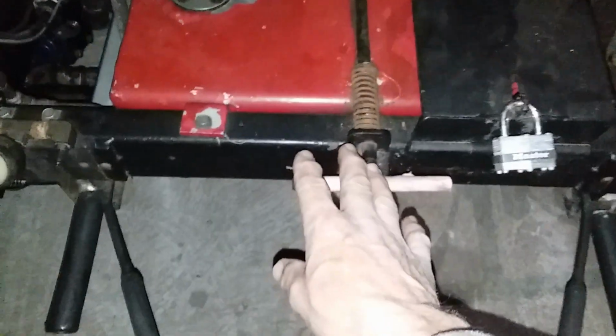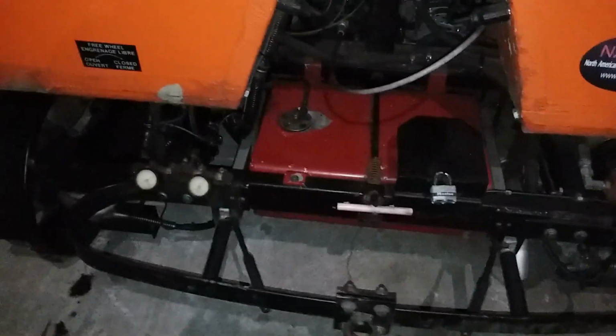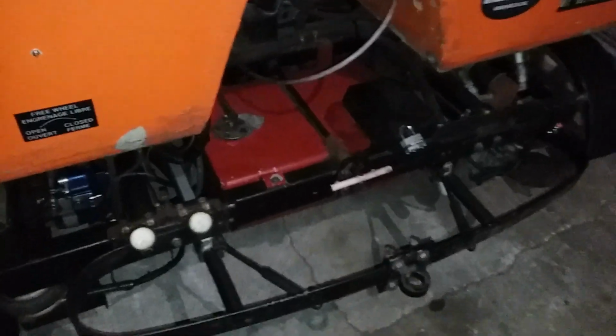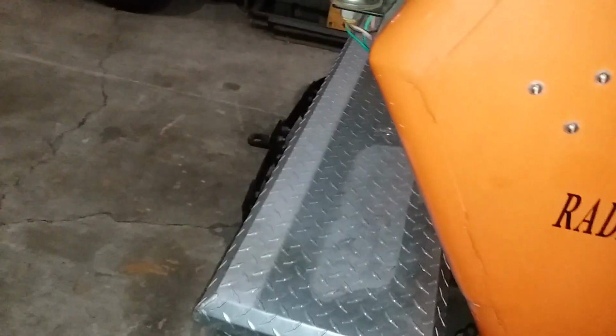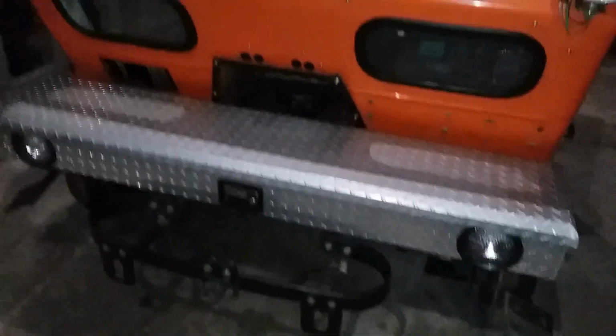Interesting bumper arrangement. This lever here is to unlock or lock the hydraulic turntable into position, and there is an alarm on it, so whenever it's unlocked or the possibility of the turntable being in the down position, there is a very annoying alarm that screeches in the cab. So that's to alert you that your turntable's down, and that's a no-no. Cars can derail or flip off the tracks if the turntable's down.